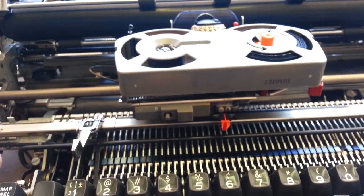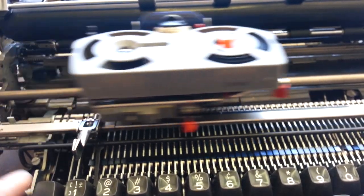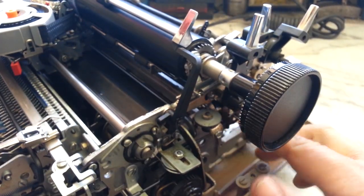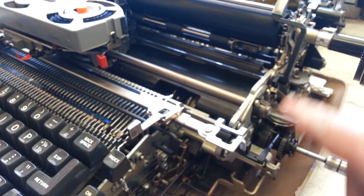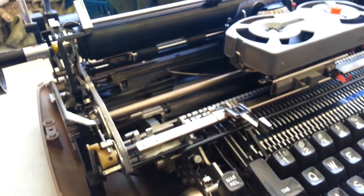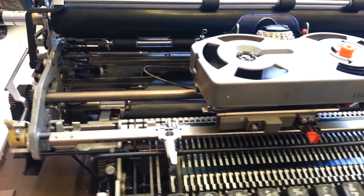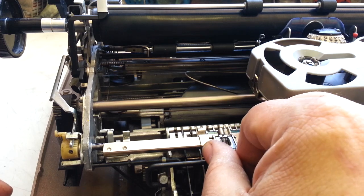There it goes already. And we're doing about one and four — it's not going to do it. So these sticky parts can be all the way over here; you think it's sticky over here, and it usually is, or it's sticky along the pathway, or this is binding with the rod. But this comes all the way over here to a sticky part that's affecting something all the way over there. This is just another case in point with Selectrics — how everything has to work and be non-sticky, or you'll have problems.